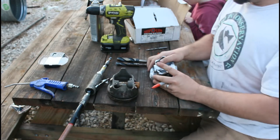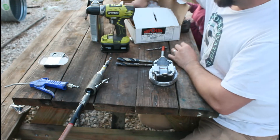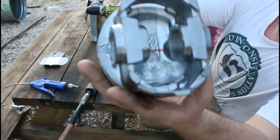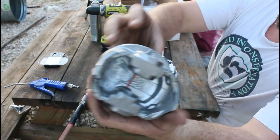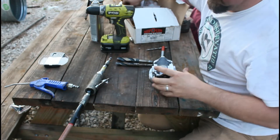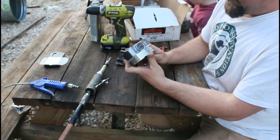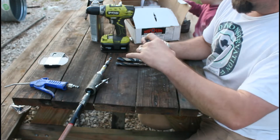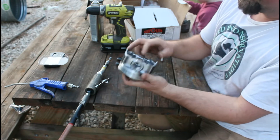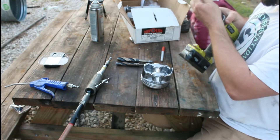Here's what it looks like after the finished product — you can see we don't have to remove a whole lot of material. I like to stay within the dome so it still has plenty of strength. This thing is almost an inch and a half thick in the dome area, so there's plenty of meat there. Where these valve recesses are it's only a quarter inch thick, and it doesn't have a problem there, so I don't see why it would here.